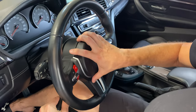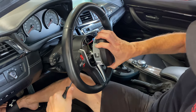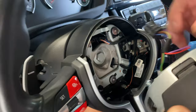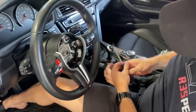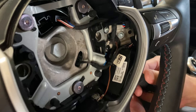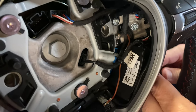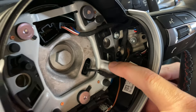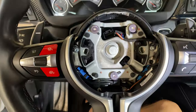There we go — that side wasn't quite out. You can feel it's very mechanical. I'm going to unclip the main harness. There's a main harness here — we want to pull that out. We don't want to undo all the wiring on the back of the airbag. I'll reinsert the screwdriver and show you where the spring is. You can see the spring there that holds the airbag. We're pushing right there to release the tab on the back. You need a little forward angle and it's the same on both sides.